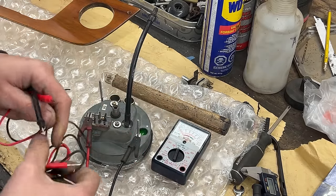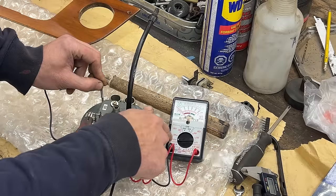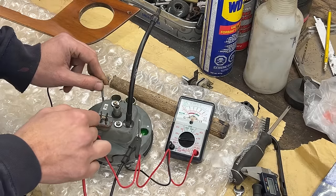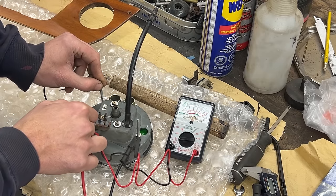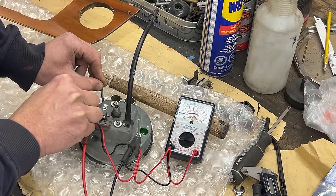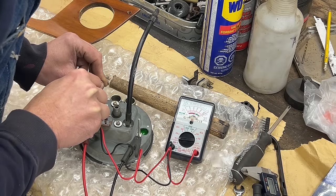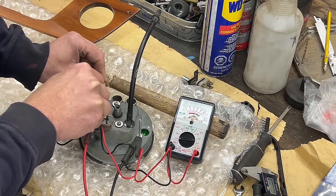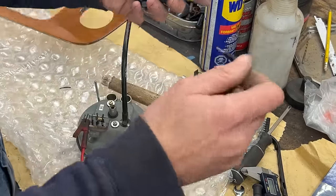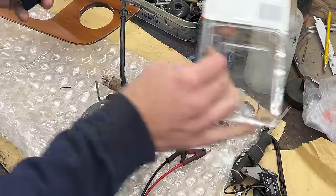The needle still varies, goes up and down, but it's not as much of a problem. I have 10 DC and 250 DC, so it goes to the maximum. That's the input. On the output, the needle goes up and down — it's between 6 and 12 volts, so the average should be 10. Even with the analog we don't have a perfectly accurate reading, but at least we can see it goes on and off all the time, so we're good.